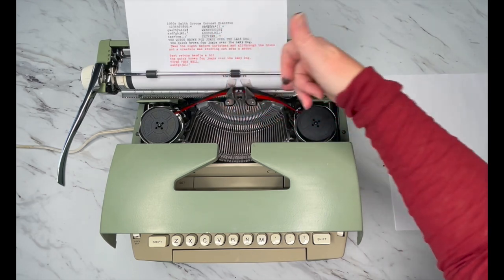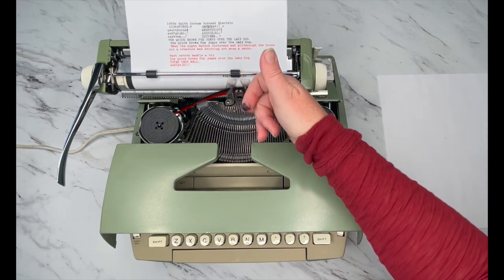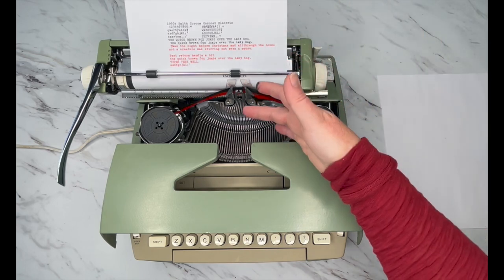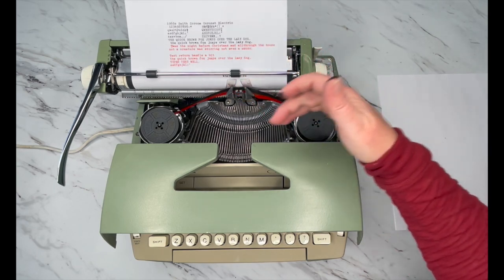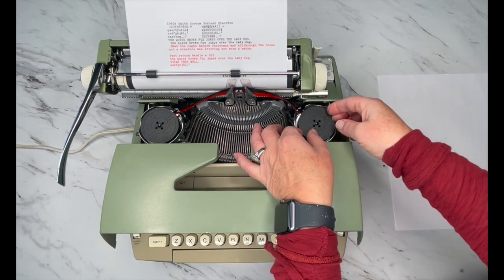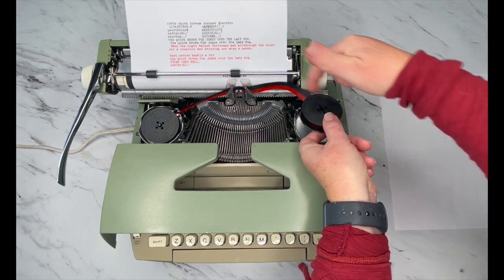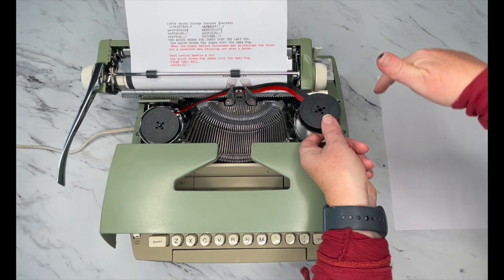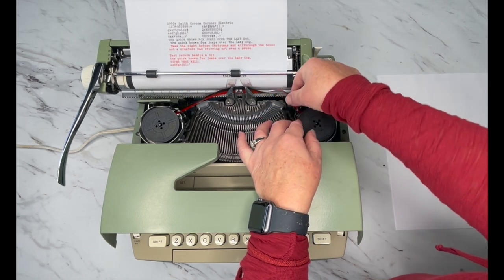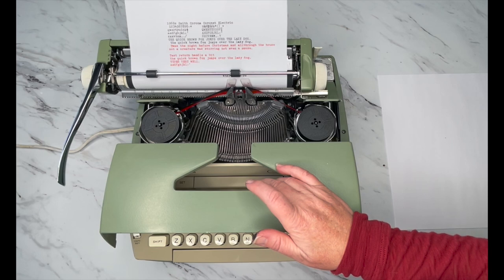You can see the ink on there and it's going to get everywhere. I do have an up-close photo of this whole area — if you just click on that product listing link, it will take you to the photos for the typewriter. You can look at the up-close photo, bookmark it or save it, and that will help you as a reference point for when you are threading your ribbon. Make sure it's threaded through the guide wire over there. Black is on top, red is on bottom. Also — I always forget to mention this — make sure the ribbon comes on the outside and around, not the other way. We do have a video on installing a ribbon under typewriter tips, and I highly recommend you watch that.